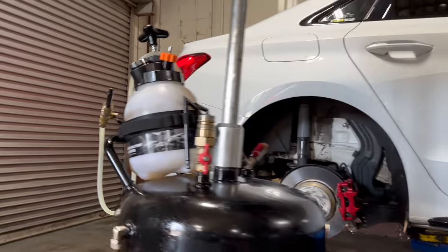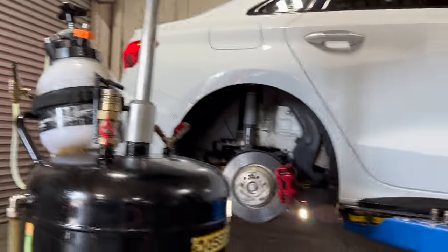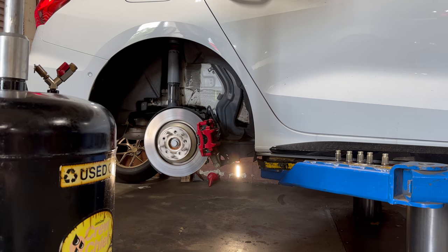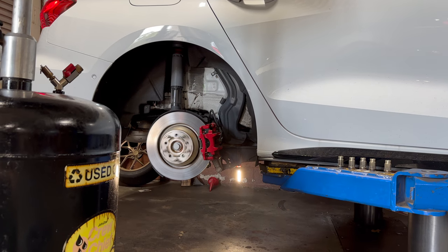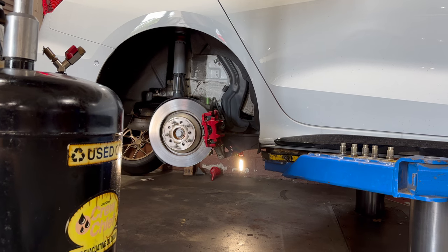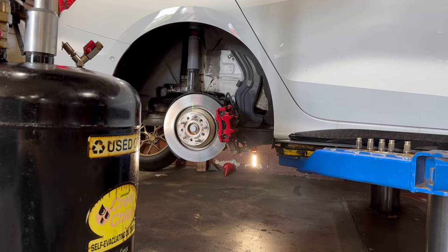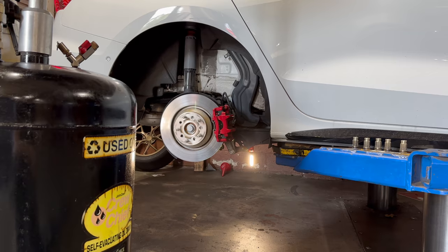What you're going to do is fill it up. I got this nice pressure gauge tool I use for transmissions and stuff. I filled it up until it started pissing out. Now I'm going to let it run for a little bit with traction control fully off, just letting it idle. It's doing its thing, getting the pump working, getting some air bubbles out. Then we'll pop the fill plug back off, make sure that it's full — it should start pissing out since the oil is getting warm and should expand. Just make sure it is full, tighten it up, and you're done.